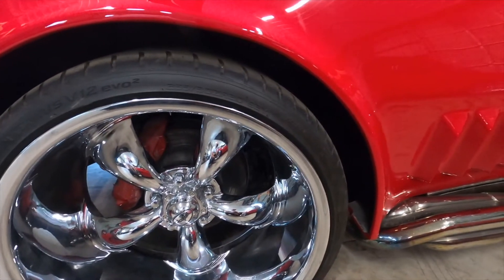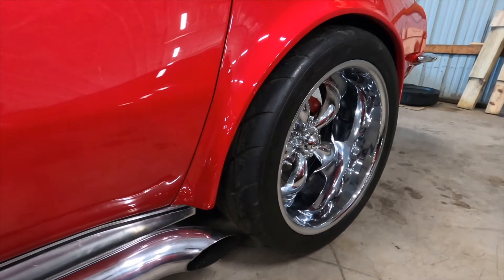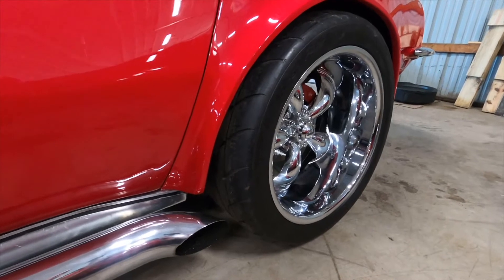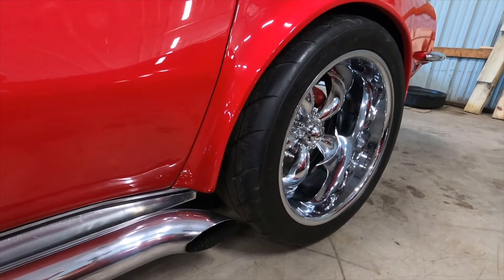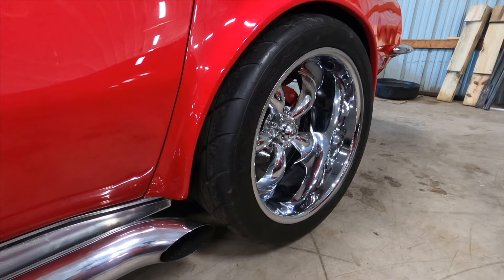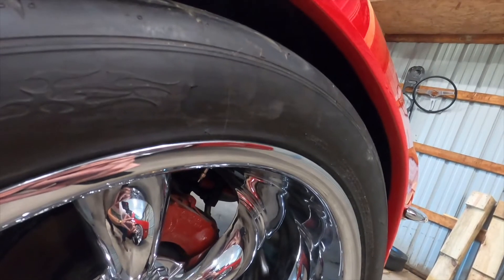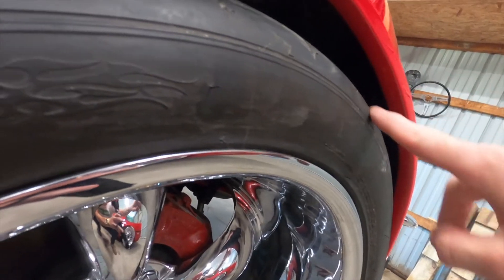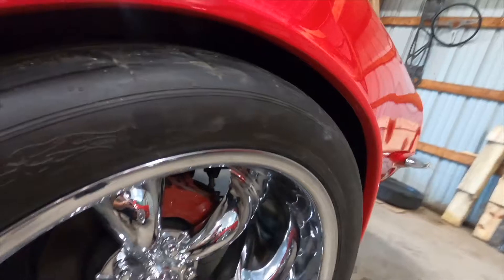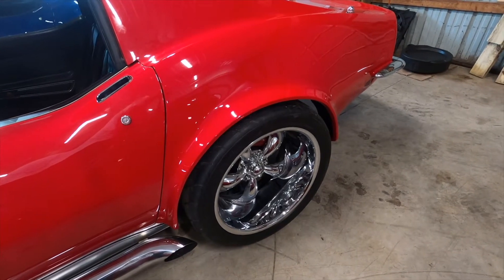Now let's take a look in the back — at first glance it looks really good. I was happy with the choice originally, but I'd rather sacrifice the giant tire than take this thing back to the body shop and smash that quarter panel out. As you can see, there's like a half-inch lip underneath here, and you can tell how close that is — it's just going to hit. So I'm going to jack it up, take these off, and get the tires swapped.